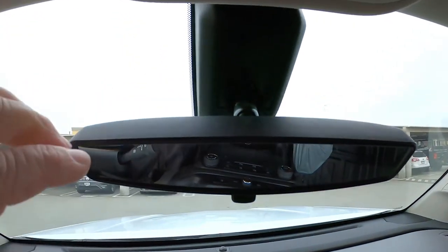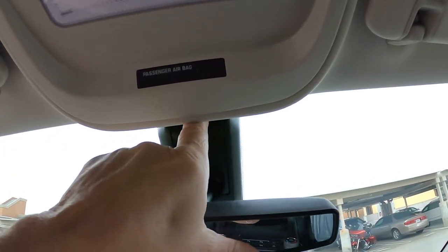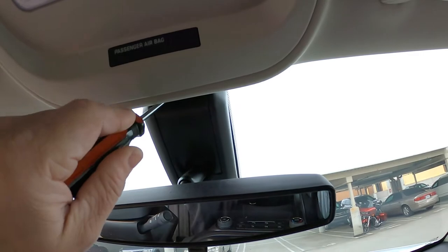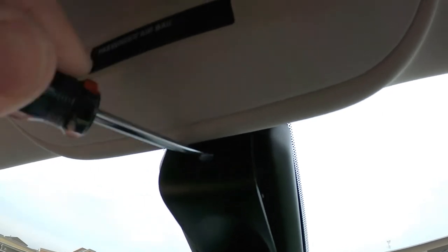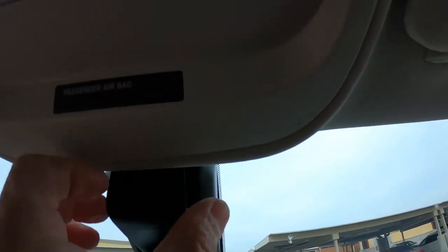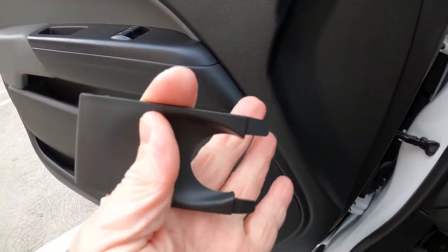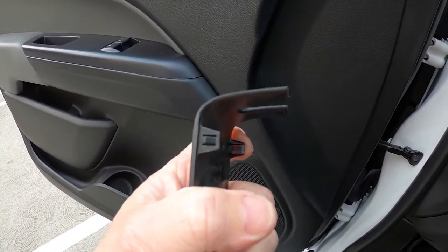So the first thing I'm going to do is just tilt the mirror down, so once I have it tilted down it's out of the way. Then up at the top here, I'm putting my finger up here — I can feel there's a little slot right there. I'm just going to put my screwdriver up in that little slot. I'm up against the plastic tab and I just put the screwdriver in there and pulled that down. Now that I have that released, I'll just pull it towards me. What happened here was the two tabs were inserted into the plastic piece, and on each side those were the clips.